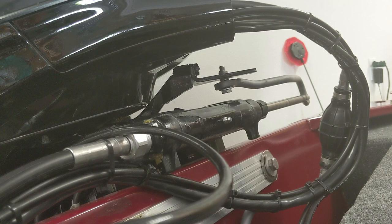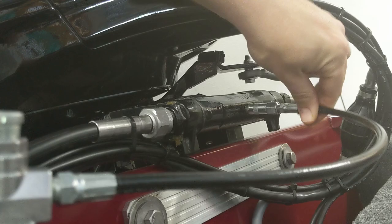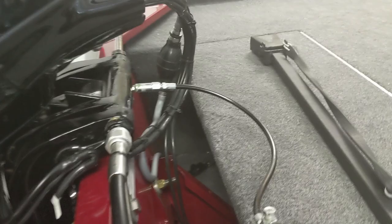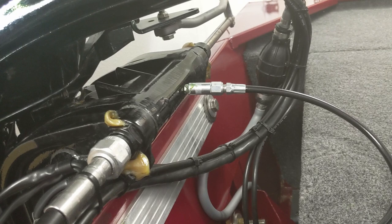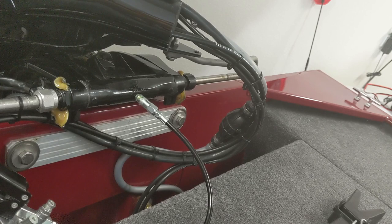To get started, we're going to start with the steering linkage grease point. You attach the tip to the grease point by just sliding it onto the point — it won't really click, but you'll know it's on there because when you pull back it doesn't come right off. Start pumping the handle; you can feel resistance once it's really going. Eventually you'll see grease coming out the other end. When grease has been used, it's going to look dark gray because there are bits of metal in it. Once the grease has pushed through and cycled out the old grease, wipe up the extra. To remove the tip, just give it a firm tug while wiggling and it should come right off.